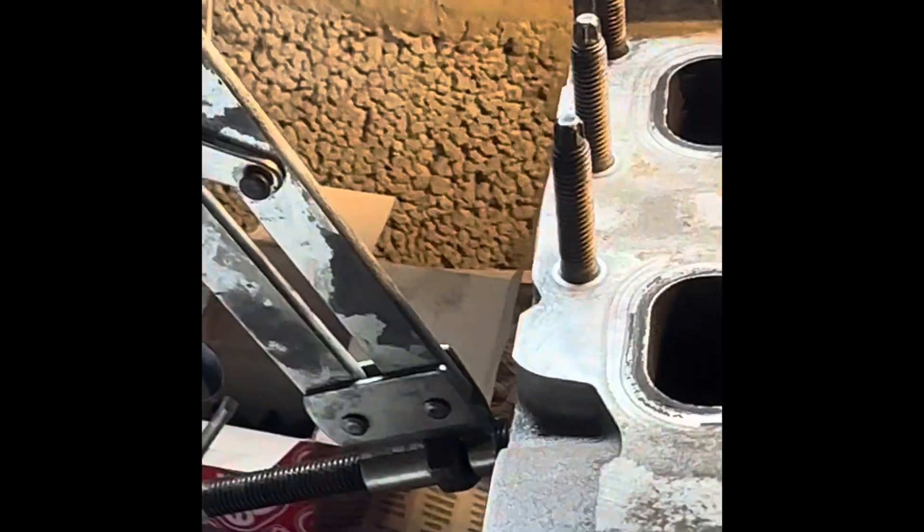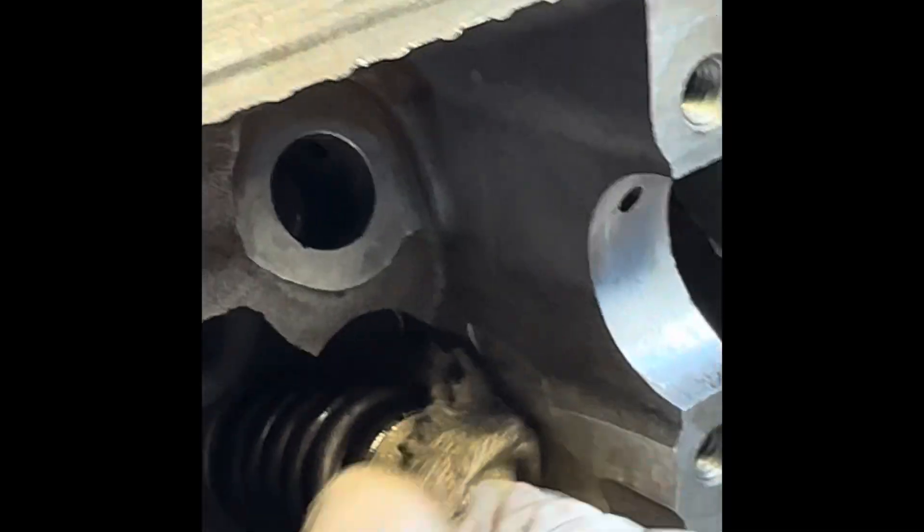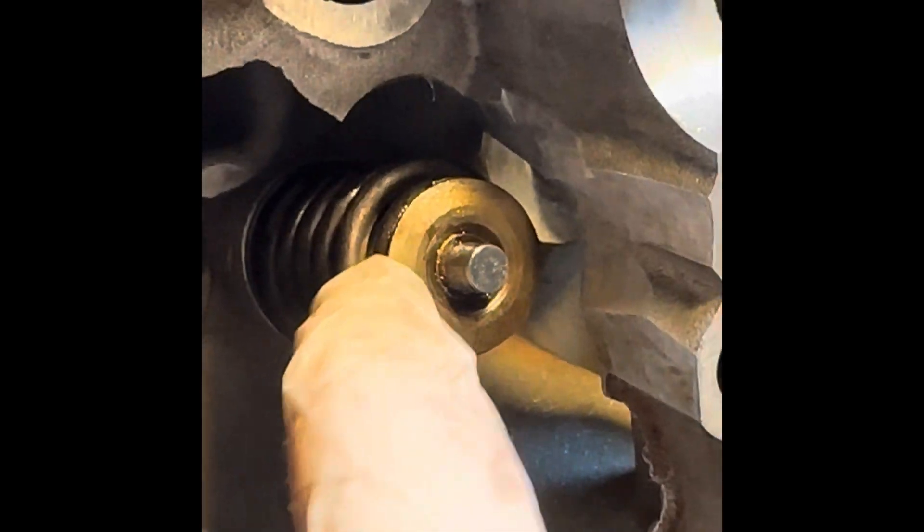So it's now hanging on underneath, and now we put the next one on the top there - that's how you do it. I've laid the next one on top like that, and now we undo the spring compressor. Now this is the really important next bit - wipe all of that grease off there, because what you're trying to do is make sure you've got a ring around there without any gaps. There should be no gaps. If you look there, there's a ring all the way around with no gaps. So now you know that is seated properly - if there's a gap, it won't be. That's a complete ring all the way around, so that's seated.